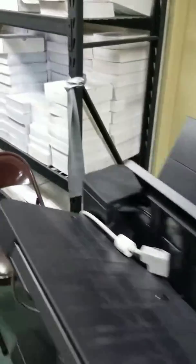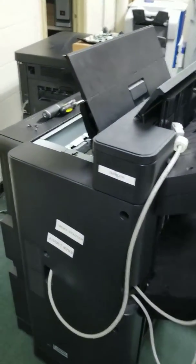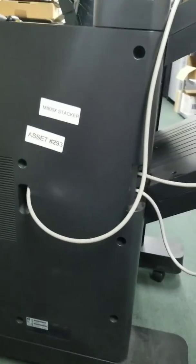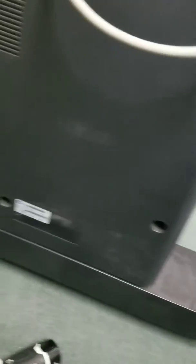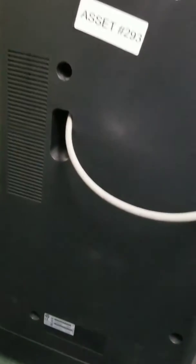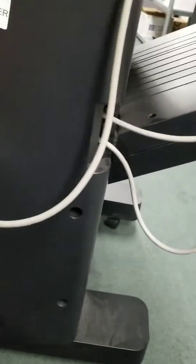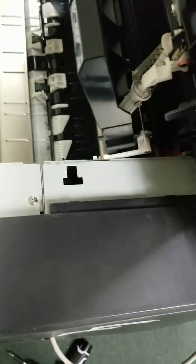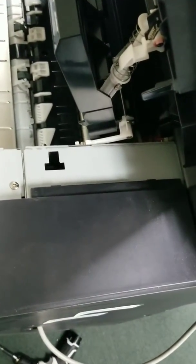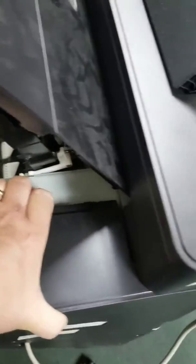To access the primary control board in this thing, you have to just remove the rear. The rear is pretty easy — it is six Phillips screws located here, here, and down here, basically all the big holes in the back of this thing. From there, all you have to do is pull out on the bottom and it will work its way loose. Just watch out for these tabs up here underneath the diverter — you just kind of pull these up a little bit, get it out of the way, and this whole rear comes off.